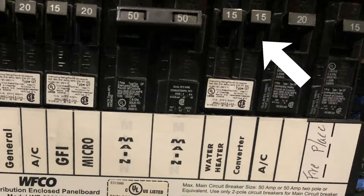After hooking up I turned the generator on — I have it mounted in the camper — to charge the batteries. I didn't notice the batteries weren't charging because the converter was still turned off, so the generator did no good. Then we headed out on a trip to David Crockett Birthplace State Park. When I installed the inverter, I moved my battery monitoring system inside the camper for a better read on battery status.